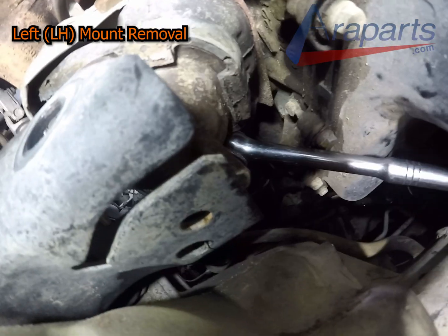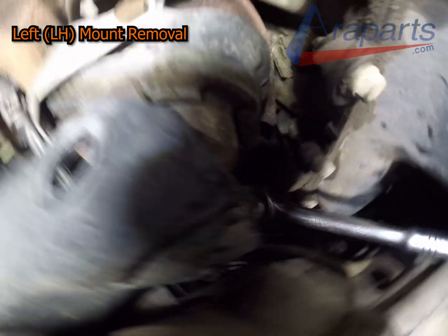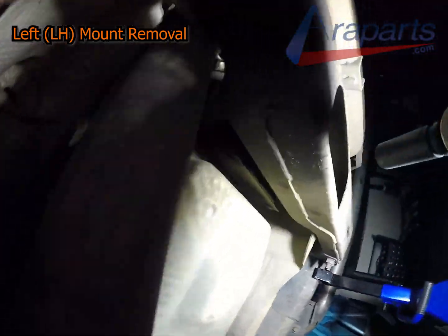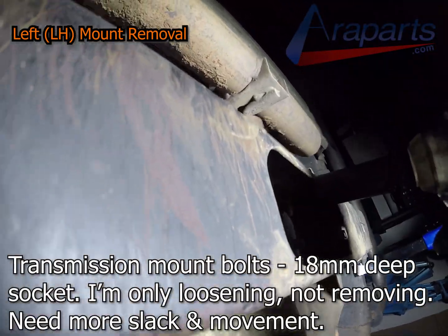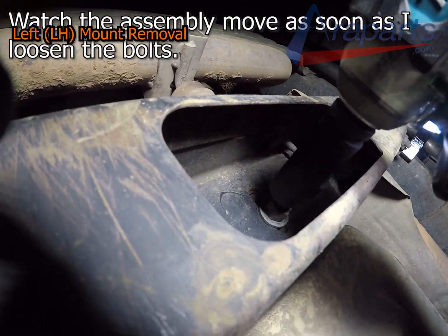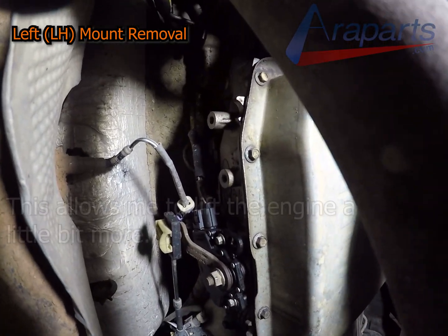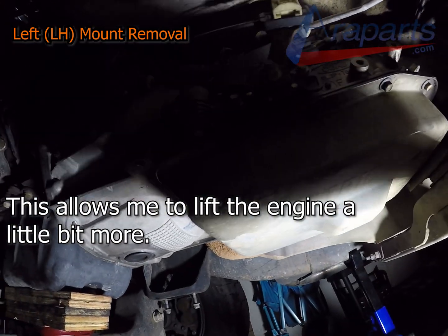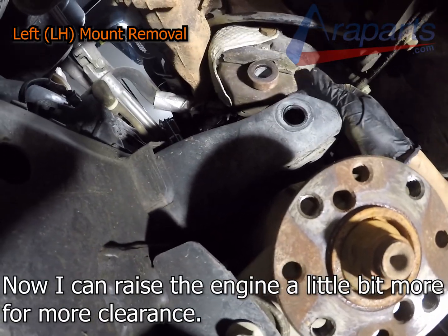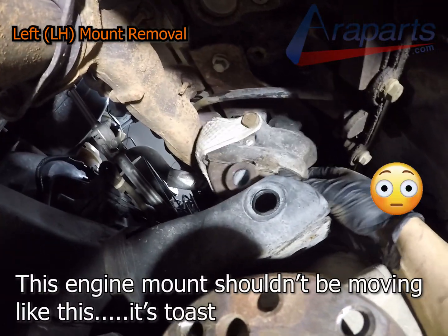Here is how I was able to just stick my ratchet up there and remove those bolts — you have enough room once you jack the engine up after the 24mm bolt is removed. I'm also going to loosen the transmission mount bolt because I need to be able to lift the engine a little bit more. Loosening these bolts allows me to do that. You may notice the whole drivetrain shifts a little bit. The plate is still bolted to the engine — this engine mount is just completely broken, it's not supposed to be moving like this. That's why we're replacing it.